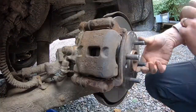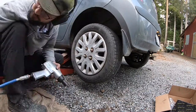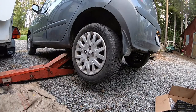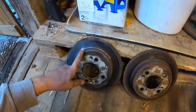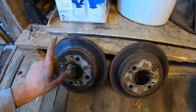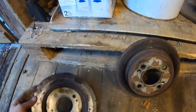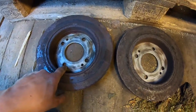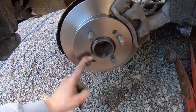Make sure the wheel is turning freely, then mount the wheel and use the correct torque on the wheel nuts. Always use a support — do not only use your jack. You can see the difference: this is the right side disc and it's a bit more dark. That very dark metal tells you it's been overheated, and if you look in here there are some spots — this one has been really, really hot. The brake pads were stuck, so they were on there all the time. This side looks a little bit better.